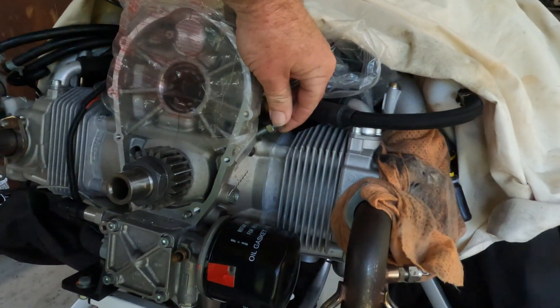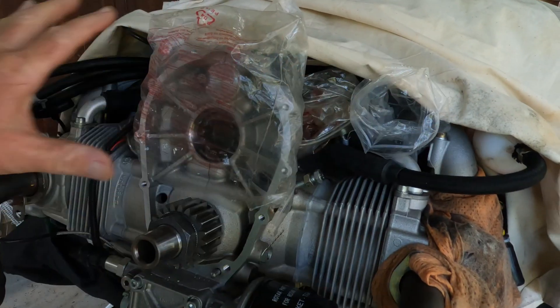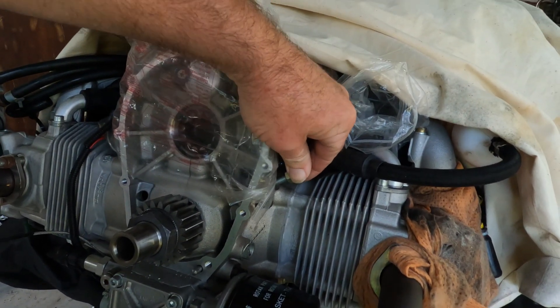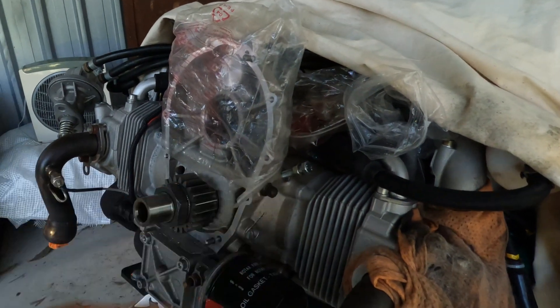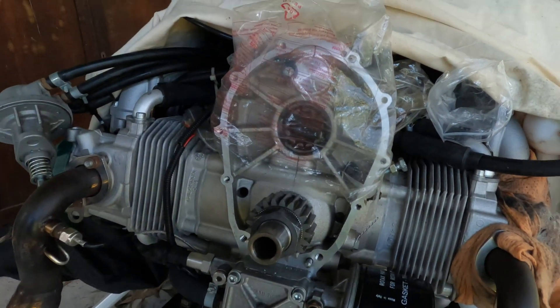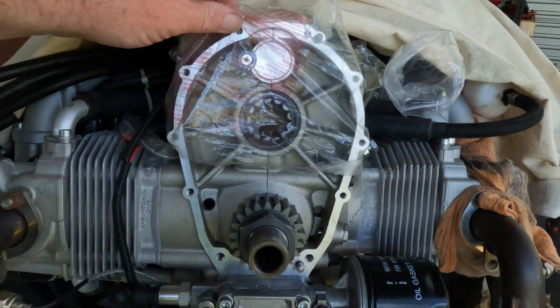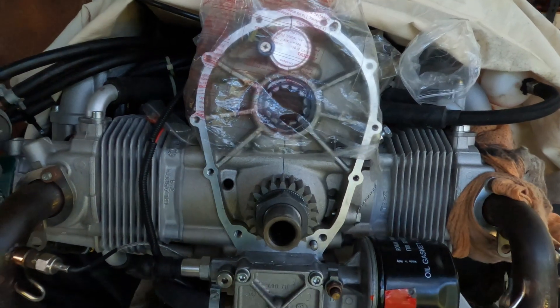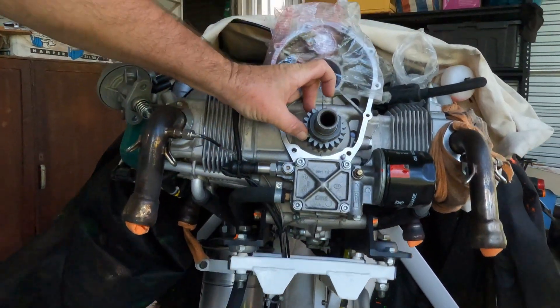I can now take this out. When you put these locking bolts in — two for the crankshaft — don't leave them in too long. If there are any temperature changes on the engine and you've got them relatively tight, and there's expansion, I'm not sure, but I wouldn't want to risk a cracked crankcase. The next thing we'll do is put the gearbox on, but we won't do that today — I've had enough dramas for the moment. The next job is to do the dial runout on the crankshaft; we'll set the dial indicator up and make sure the washer and everything is still in the right place and hasn't caused any distortion on the crankshaft.